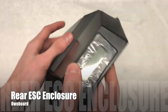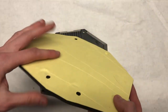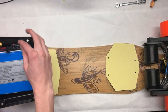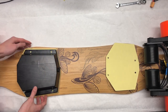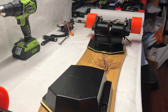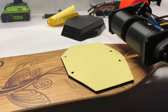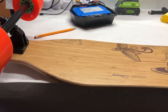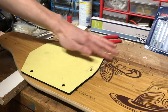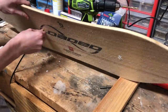The rear enclosure is also from Ownboard and resembles the boosted rear enclosure — not quite as sleek but it'll get the job done. Included are nice foam pads which help with waterproofing. We did a rough layout of where everything would sit on the deck to determine where to drill holes for the enclosures and where wires would go through — battery on the front, ESC rear enclosure on the back. Once we dialed in the component placement, we mounted the adhesive foam pads to the deck and drilled holes on both the battery and enclosure sides for the wires to pass through on top of the deck.